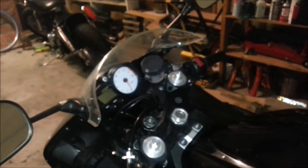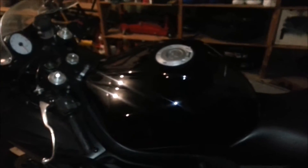We did a five-hour ride the other day, average speed of 70 or so — maybe higher. I know I got it up to 150 at one point and it did well, no drawbacks. Well, one drawback — I need a new chain and sprocket set real bad. This one is really loose and really dry, and I assume the sprockets are worn a bit. Yeah, you can tell they're kind of too sharp. I'll get the stock set — I'm going to keep the 530 chain instead of doing a 520 swap, because it's easier, cheaper, less to worry about down the road, and I can just refer to the stock settings.